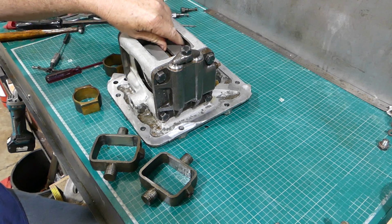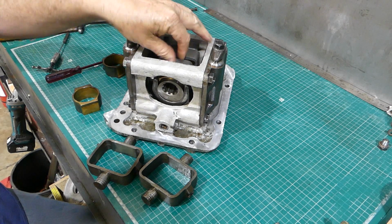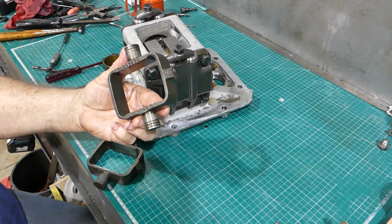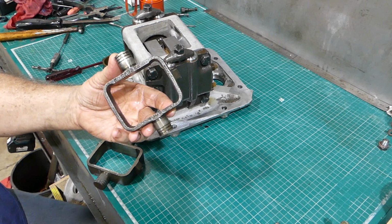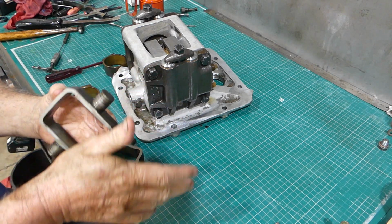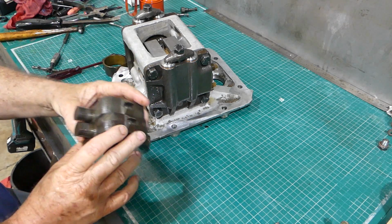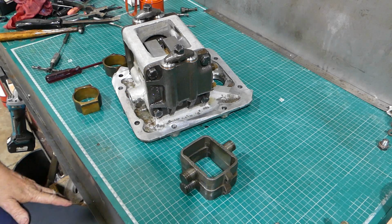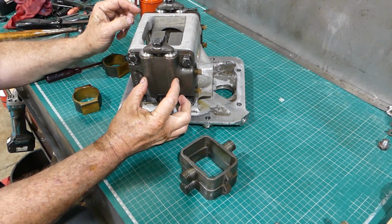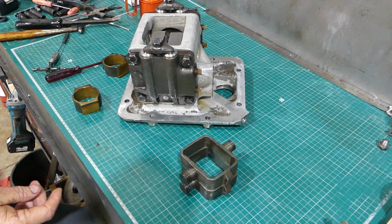The other thing though is that with the aftermarket pistons, they are flat machined on both sides. So where normally you could just use the cast side versus the machine side to give you a hint on which way it went, you'd have no trouble. But the aftermarket parts didn't have that, so that's all right. But the problem I had was the pistons were just out a little bit wide and I couldn't work out what was going on to bring them in.